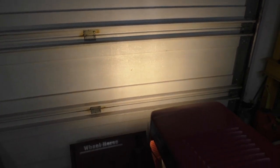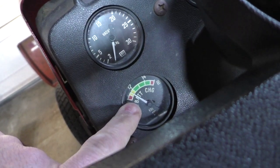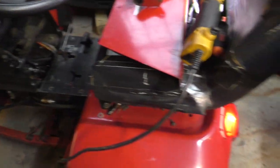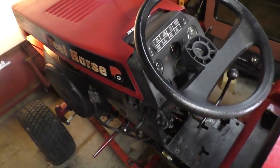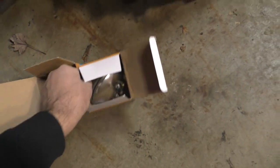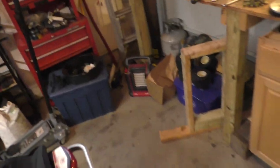That is a huge difference over what we had. With the lights on, you can see where before I was pegged in the red — now I'm just in the yellow. I have my tail lights which are regular incandescents, probably about 5 watts. The charging system was actually having a hard time keeping up with those old lights. There was 70 watts of light before; now I've gone down to 18, so that'll help my battery situation.